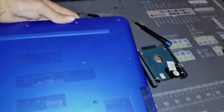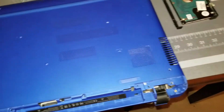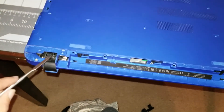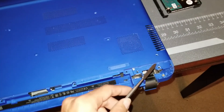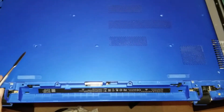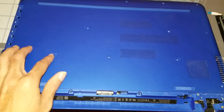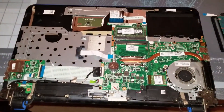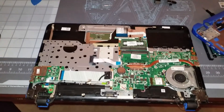Quick recap: undo all the screws starting with the CD tray, take out the battery, undo every screw you can see, use a flat pry tool with a rounded edge on the end bumper caps — two screws hold those in, and more underneath. Undo the hinge mounts, then look for the two oval inserts with stickers covering them; use an exacto knife to pop those off and reveal the last two screws. Pop it off, access your internals, upgrade what you need, then reverse everything. Thanks for watching — like, share, subscribe, and comment below!